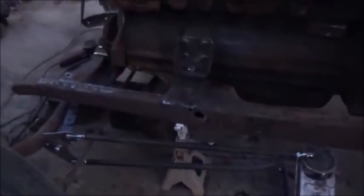And I've got enough stuff to make the rear ones too, but it's the steel I got for it, it's solid, but it's pitted some, so we'll have to clean it up, but we'll use it. Now this is 7/8 solid instead of the 1-inch, and so I use 7/8 there, and then I'm using 1-inch on the back. These are 28 inches long from jam nut to jam nut, and normally I think most of them are about 27 inches long. I probably could have went a little longer with this engine, this frame and stuff, but that's okay. The piece he had, I could get 4 pieces out of to make this. So that's all I was worried about.